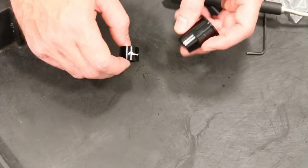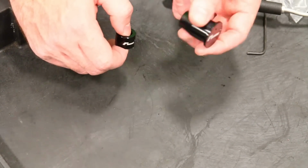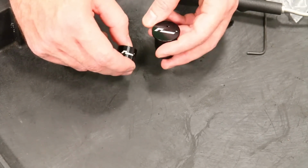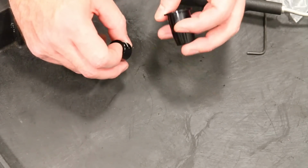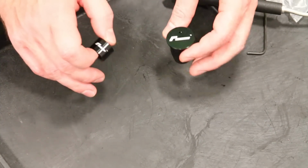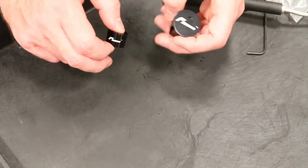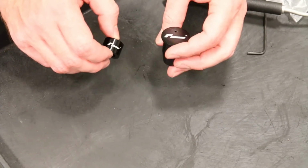Okay, so these two pieces, this is a plug for if you have certain models, not this car because it doesn't have the different setup that you would find on a Golf R or an S3. TTS and TT would also likely be the same, as well as Quattro A3s. You plug the washer cap or the washer neck with this because you have to delete it where the catch can actually mounts on the engine mount. So they do have a relocation kit that is available separately. We will link to that in the description where you can find a relocation kit for that. But this is for if you're not using that particular setup.